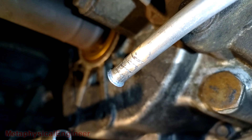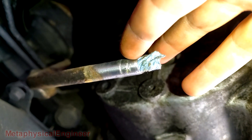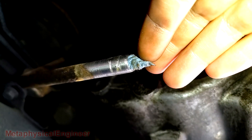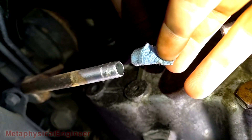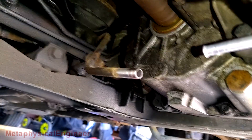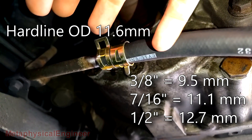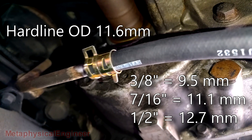Putting a partial flare on the aluminum to stop the tube from backing off. Took a little extra prep to prepare the old return line to accept the new flex hose — slightly chamfered the edge so the hose slides over without cutting, then carved a couple little grooves into it so it has some bite on the hose to reduce the chance of it simply popping off. Not much pressure, but I'm not taking that risk. Warming the hose with a heat gun makes a world of difference, as does putting a little bit of transmission fluid on the hard line so it slides over easy — and when I said easy, I meant with moderate to severe struggle. This pipe is 11mm and change, so bigger than three-eighths, smaller than half, so had to fight it a bit.